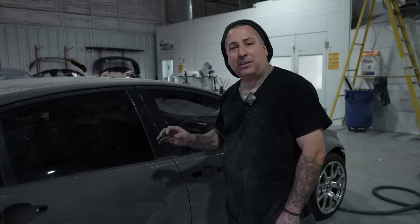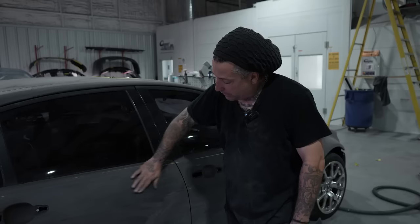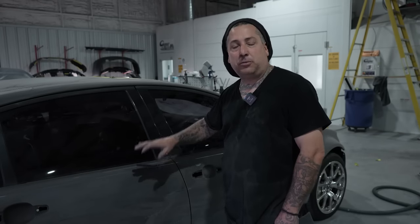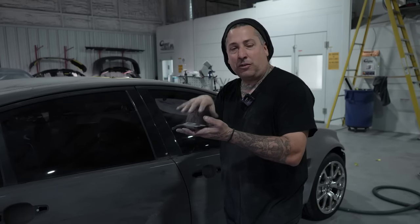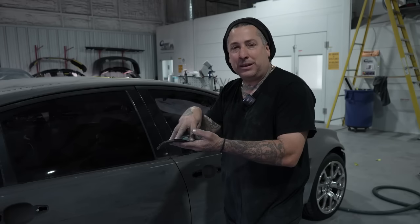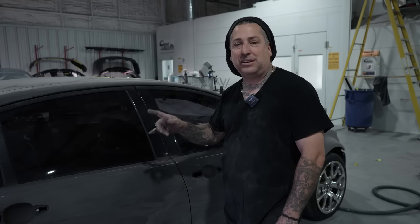But all kidding aside, I got to say, for the 2K, this stuff sands really nice. It blocks down easy, it sands easy, and it comes out nice and smooth. So this here is a very smooth finish now that we finished this with the 600. And that's going to give us a nice layer to put down our epoxy on, because the coarser you have it, the more it has a chance to settle into those scratches. So you don't want to go too fine, because you want to have adhesion, but you also don't want to go too coarse. That way when stuff dries, it starts to tighten up into the actual scratches. So we made this one at 600 grit, which will give it a good adhesion for the epoxy sealer, but it won't be coarse enough to have any problems with it. So let's go ahead and get this thing blown off and get it in the booth.